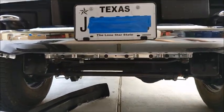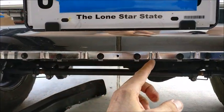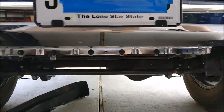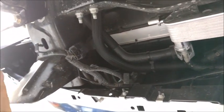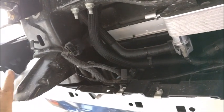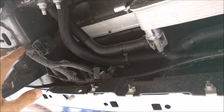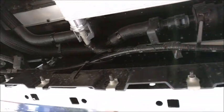It's about half an hour's work. First thing you've got to do is deal with the wiring harness that Ford, in their infinite wisdom, left hanging down here behind the air dam. It goes to the fog lights. If you don't have fog lights you won't have to deal with it, but I do. I tied it up here using wire ties, keeping it safe. These little shovel guys here — I think they're to keep you from going over a small car if you run into them. Make sure it's not chafing, snug but not tight, and you're good.